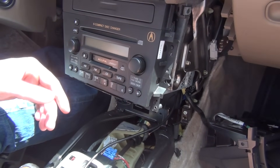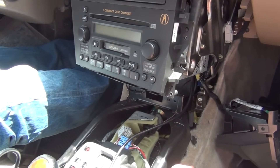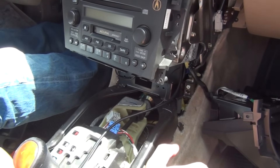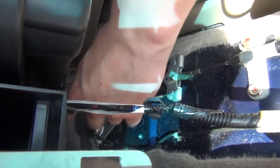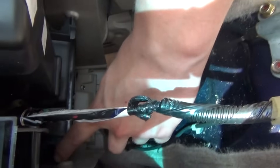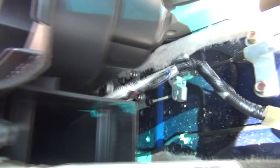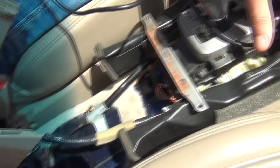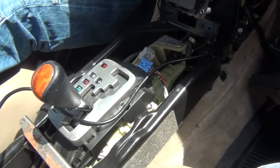But if you need to remove the kit later, it's almost impossible to remove it that way — and that's why we're showing all the steps. Plus, this is a good way because if you want to run the wires into the armrest, everything is apart and you can do it. With the armrest, we already drilled a hole here where we're going to put the wires for our iPod and auxiliary so they'll be in the center console. If you plug in the kit by the side, it's almost impossible to put the kit into the armrest — that's why we're doing it the long way.